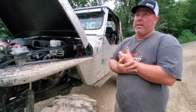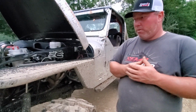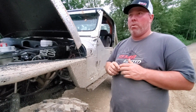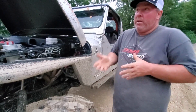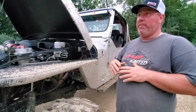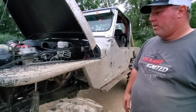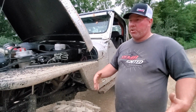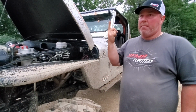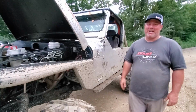The last time I broke the oil pan, I put in a Hummer oil pan that we picked up from DVR Performance one day in that video, if you've seen it. Those guys hooked me up with that, and it's almost 2 inches shorter, so it really helps out. Hopefully I have more room now for that skid plate to flex, because that's just what happens. It doesn't bend, just a little flex, and it comes back down, and it was enough to crack the aluminum oil pans, because the stock Chevy ones have this little half circle where the drain plug comes out, and it was just pushing on that and busting the oil pan. So that happened twice. I felt like an idiot both times, but that is what it is.